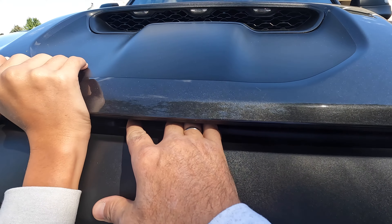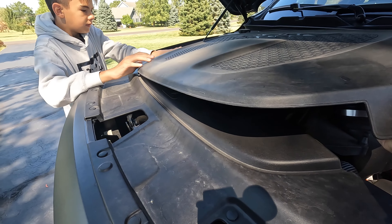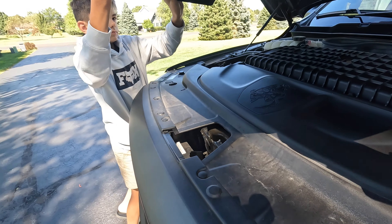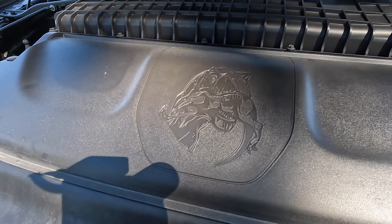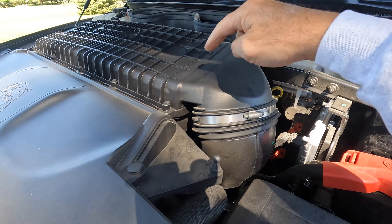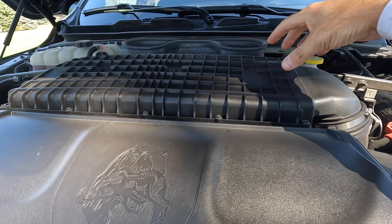What's next, Charlie? The engine air filter. All right — step one, pop the hood. So under here, Charlie, let's pop this guy off. Lift up there, lift up on your side, then pull it straight back and set that on the ground. Still one of my favorite parts — sorry, Ford owners, but that's a good one. If you've never seen that Easter egg before, that's a good one. So now the air filter sits under here. We're going to get a socket, unzip these clamps, and the air filters sit under here.